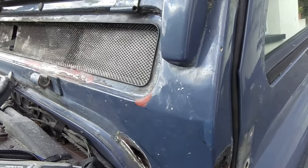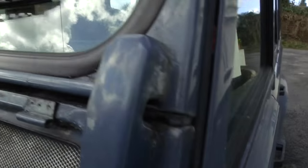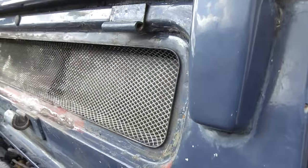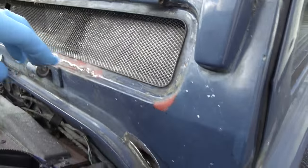She has been leaking, so I've changed the windscreen seal — which you probably saw in one of my last videos — and I've actually taken up the foam seals that normally go onto the vent flaps and replaced them with the old series rubber seals, which has helped to stop the leaking.